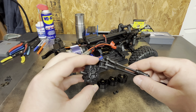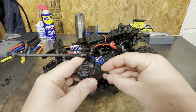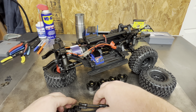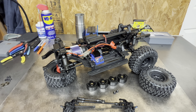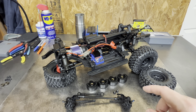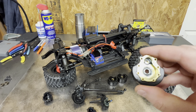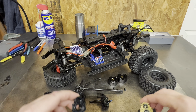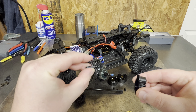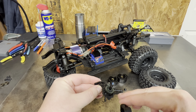I've not watched any videos on how to do this, so I was just kind of looking at the front of the truck to see the best way. These two bolts on the front are very easy to get to, obviously. The ones on the back, not so much. Instead of fighting them on the truck, I figured it's just a top and bottom — they have their own little spacers that go in the plastic, their bushings, and the steering linkage. Since the steering linkage was already taken off, I just took the steering linkage to the servo off, so I can flop it out of the way and still get to the back of all these.